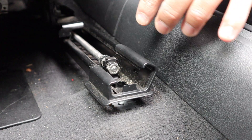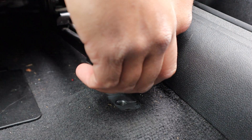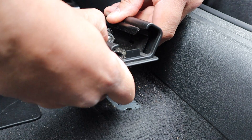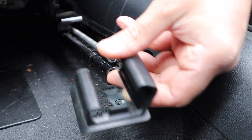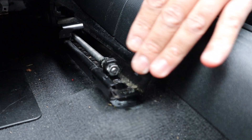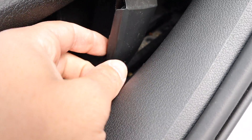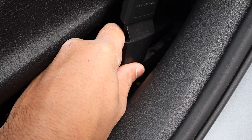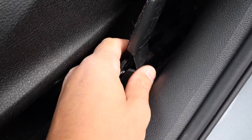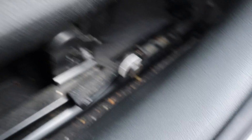The seat is now completely unbolted. There are these plastic little covers here — it's a good idea to remove those as well, but be careful because they're very brittle. You want to release left and right side, then straight back. Once the seat is out of the car, those plastic pieces won't be hitting anything. One of the last things to do is remove the seat belt clip — there's a little clip on either side. Release both sides and then pull that out of the way and slide. That's the seat belt done.